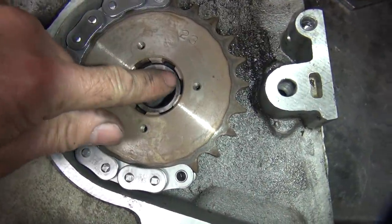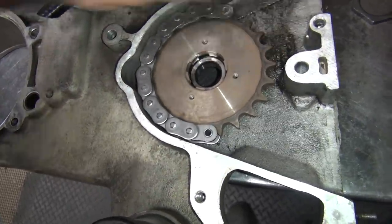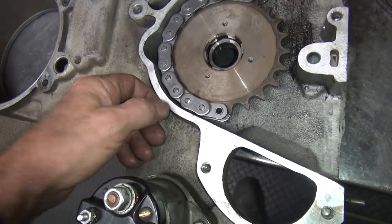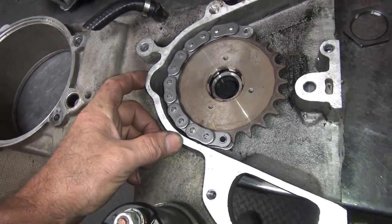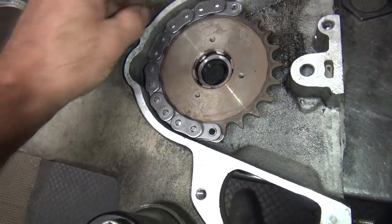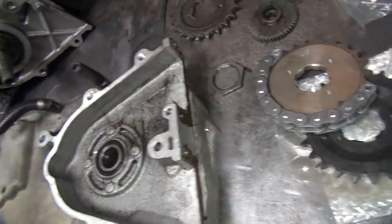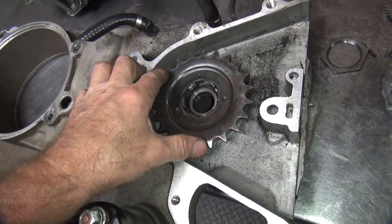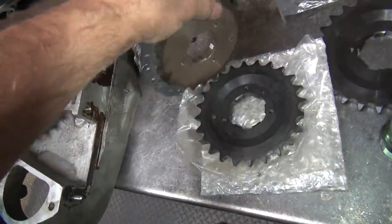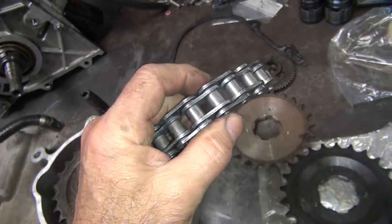You can see how we're not quite far enough yet. So that's going to have negative clearance right now. It fits nice and round though, but it might drag slightly. It'll clearance — it'll have to clearance because it hits. So the only way you can use this is to go in there and do some machining. I'd have to cut this circle bigger to about here, thin it out. It's just not worth it for six miles an hour, I don't think. So that's called making it fit. They are committed to 22 tooth for a reason — that's as big as you can put in there and still work without eating up everything in sight.